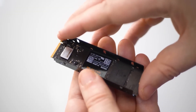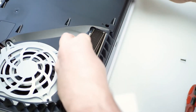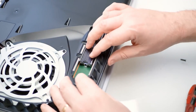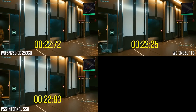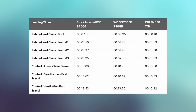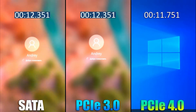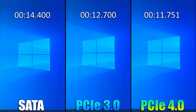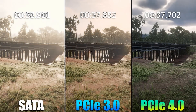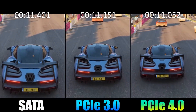For example, when installing a Western Digital 750 SE SSD providing a speed of only 3.2 gigabytes per second — that is, twice as low — the real difference in load speed was only hundreds of milliseconds. Only one game showed a difference of two seconds. I would not call such a difference mind-blowing. PC users went as far as to test and compare SATA, PCIe 3.0, and PCIe 4.0 SSDs, and the result was kinda predictable. Yes, the cheaper and slower SATA turned out to be slower indeed, by as much as half a second, sometimes even one second.